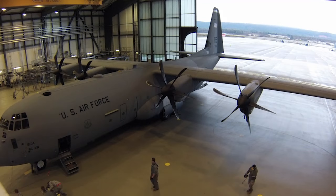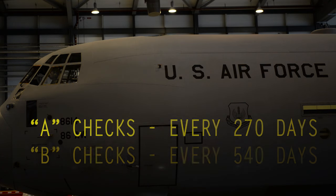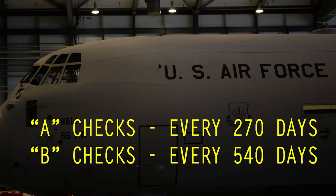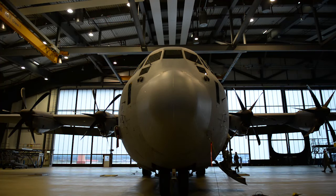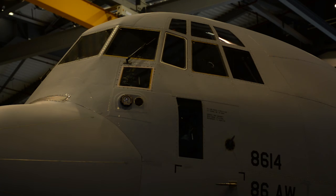This is a calendar inspection. Every so many days the aircraft has to come in for a really in-depth inspection. We get into things that they don't inspect on an everyday basis. Every three years you're going to come across the C check itself. The C2 check, which is the most in-depth, is what we're coming up on right now. Anything and everything on this aircraft is going to be touched and looked at by us.